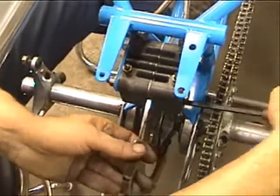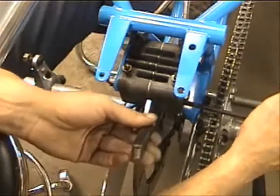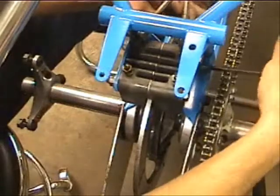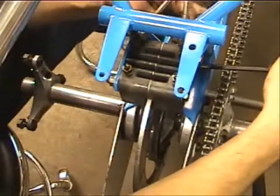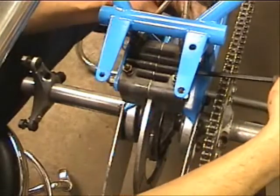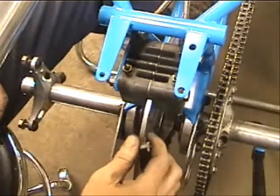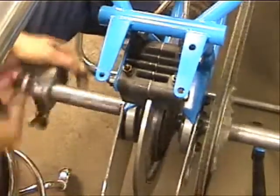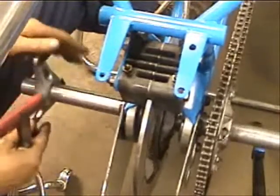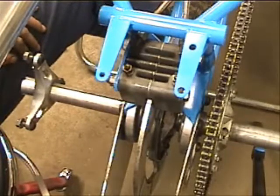Just check it over in a few spots. I always come from the side that I'm actually doing the adjuster — if you're doing the forward adjuster, come from the front; doing the rear, stick the feeler gauge in from the rear. Just try and get them as even as possible. Make sure there's not too much drag. And you're done — all there is to it.